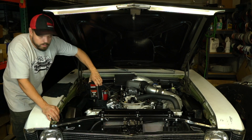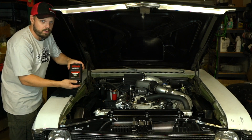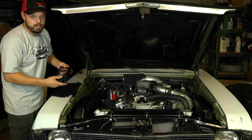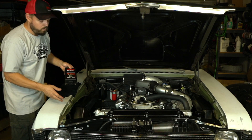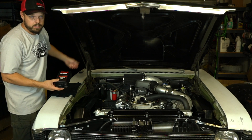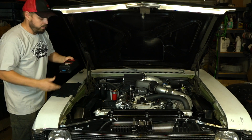It's pretty flexible where you mount the CDI box. On this Nova, I've decided to mount the GoSpark inside on the firewall. This is a safe place to mount it — it's going to be away from water and weather, inside where I can reach it underneath the dashboard, and easy to service. I think it's a perfect spot for this car.